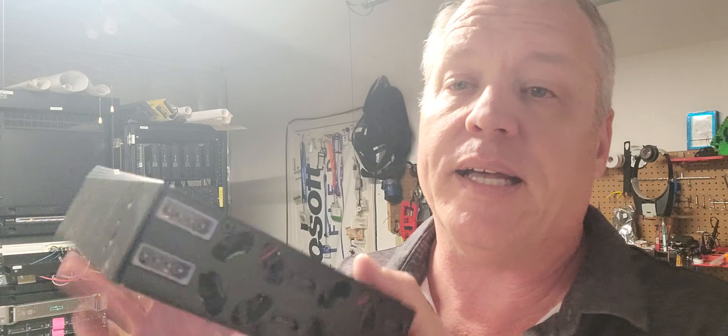When you get something like this — it's about $120 — you can get eight if you want, you can do what's called the double split. On the back it has SATA connections. So you need to get one of these: it has four pairs of SATA here but it has a SAS head here. It's not a SATA-to-SATA cable, it's a SAS-to-SATA interface. On the back you have a power output and four points of contact which you lock into place — it has a lock on each of these connectors. One thing to take notice: on the back of your drive enclosure it says SATA 1, 2, 3, 4. And on your cable it'll say port 1, 2, 3, 4. So you want to connect these in the correct sequence.